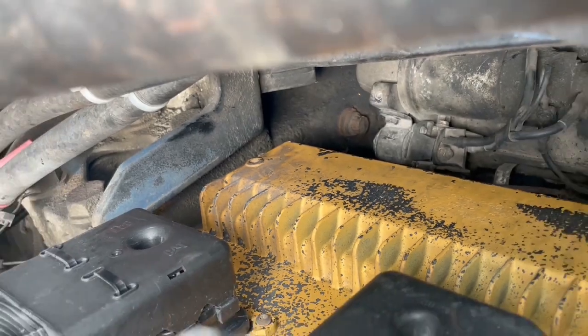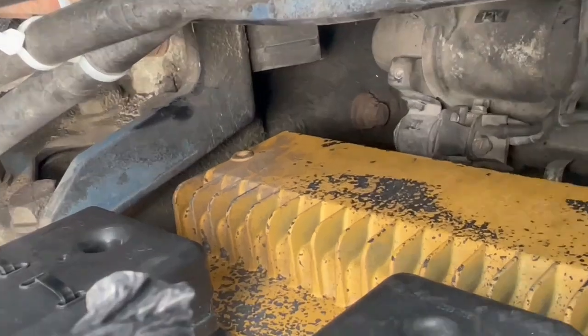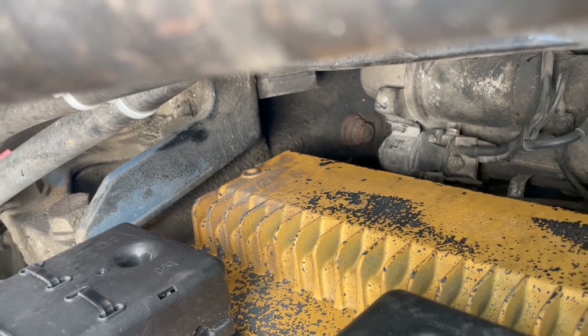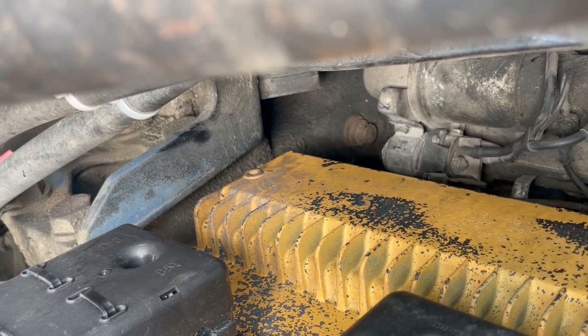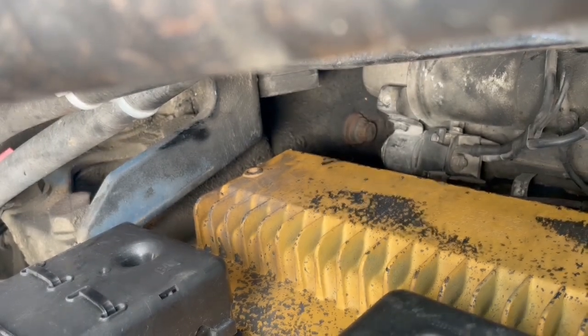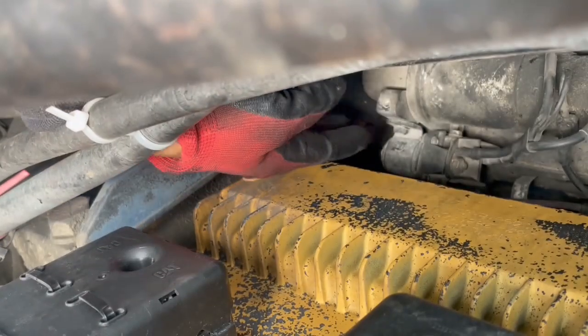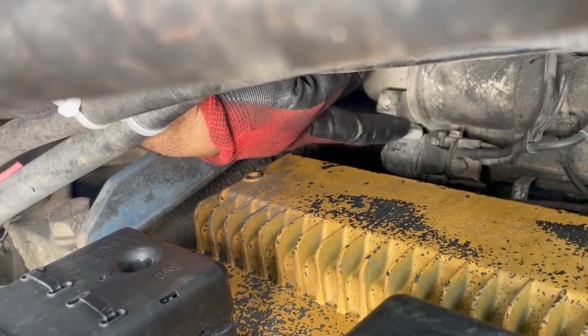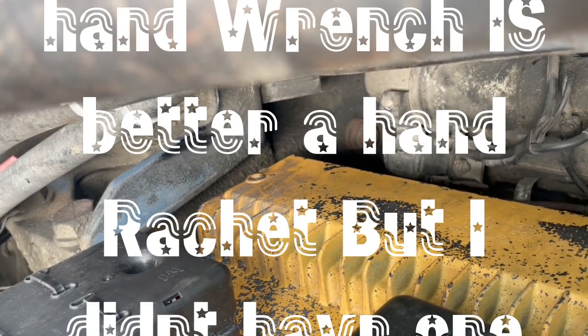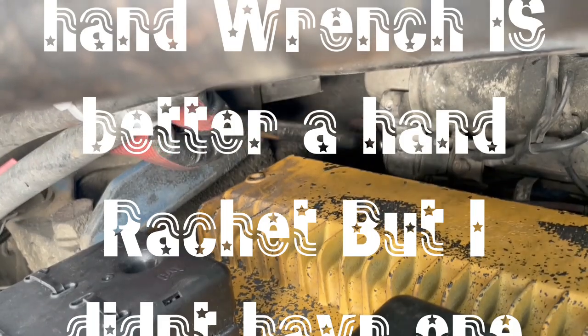All right, let's get it. So for this one, you have to adjust the solenoid to use this type of wrench. What happened is you can't get to the bolt, as you use this type of wrench, the curvy one. You can see that this solenoid originally came with this side right here, so you have to put it on the other side. That's for the ignition one. So we're gonna use this. You see the curve? It has a good grip on the curve. So the 5/8 is out. It was difficult and uncomfortable. The other two are so easy to get out. I'm not gonna touch them.